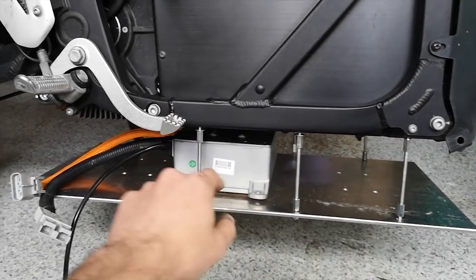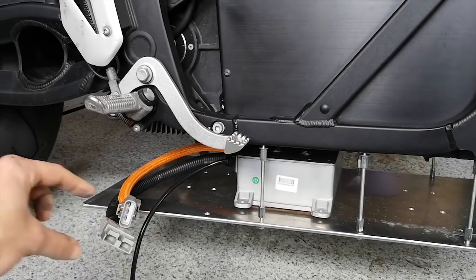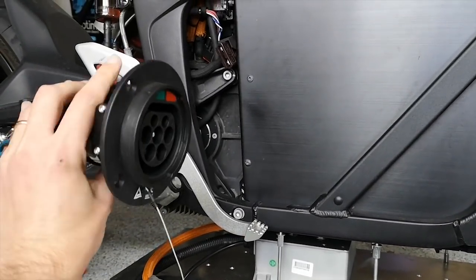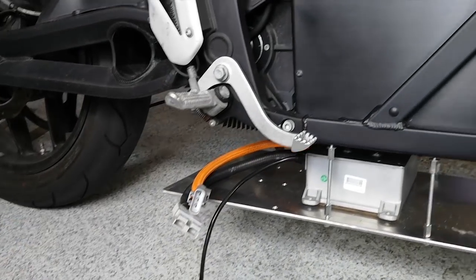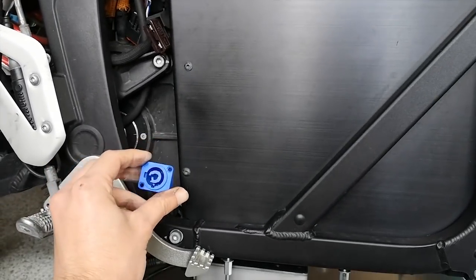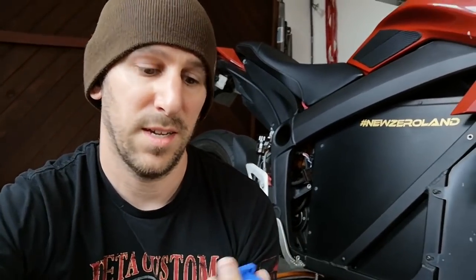The idea is once I get all three in here, I'm going to have these Sumitomos instead of going to a whole bunch of Andersens out to either a J1772 inlet or a huge massive Mennekes Type 2 inlet. It's just going to go from here up through here and I'll have a little Neutrik connector for each charger. The reason for using these instead of having all the chargers linked into just one inlet is so that I can access the chargers individually for different charging situations around the country, because the infrastructure in New Zealand has just so much variety.